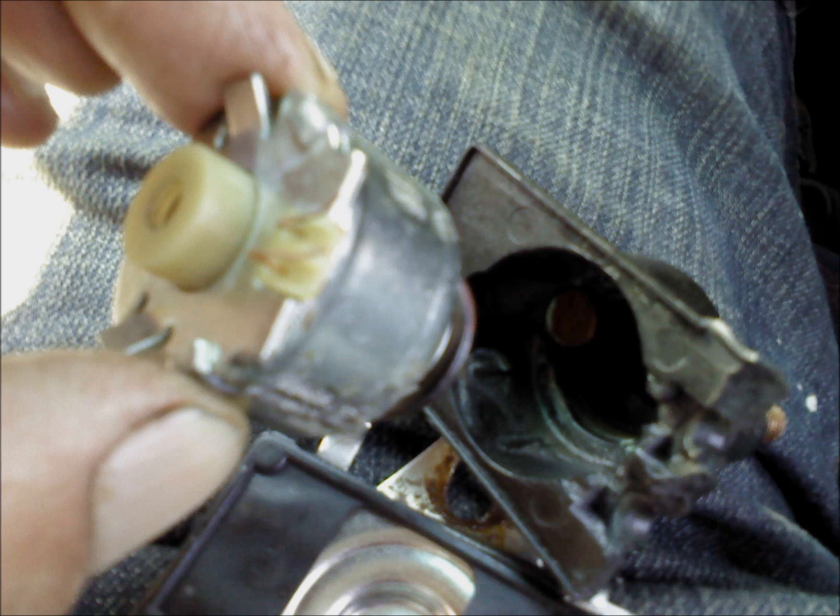Press the tags out of the way, push them tags back — two on each side — and remove the coil from inside. You may have to break the leads off the two nuts. You'll have to solder them and put some bullet connectors on to reconnect them if you've had to destroy the little nuts on the plastic to get it out.